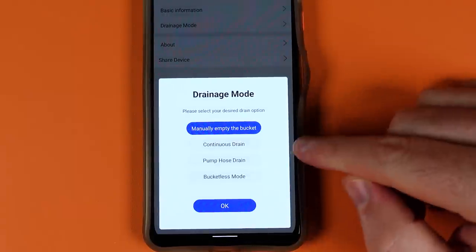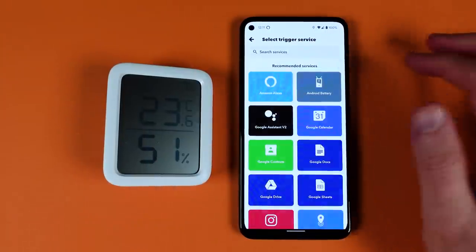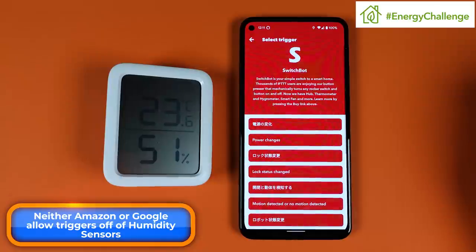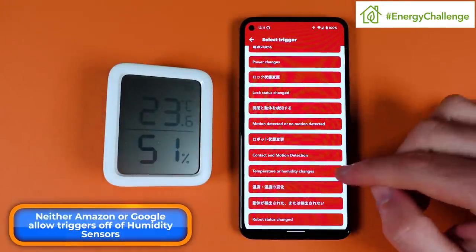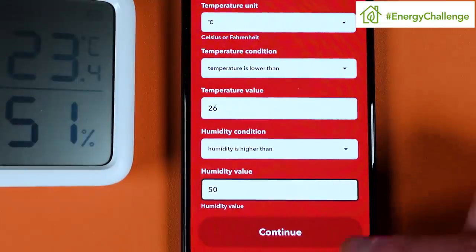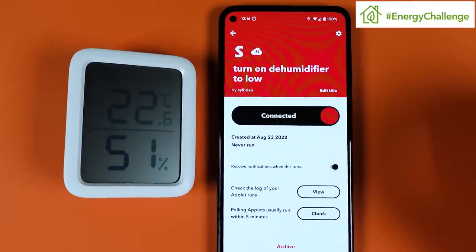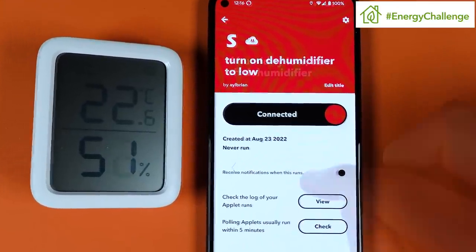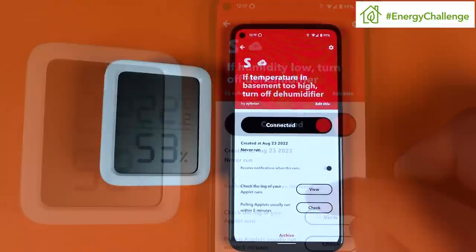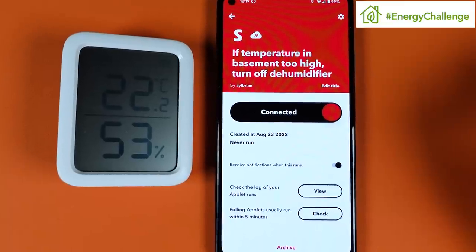You can adjust all the modes for how you drain it. The most useful thing to me was IFTTT because of those humidity sensors. I configured the SwitchBot humidity sensor, and what's really great is you can use temperature and humidity as trigger conditions. I ended up creating three different applets: turn on the dehumidifier to low at a certain humidity, turn off the dehumidifier once it's low enough, and if the temperature gets too high — because it does pump out a little hotter air — turn off the dehumidifier again.